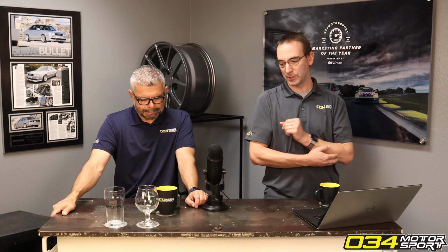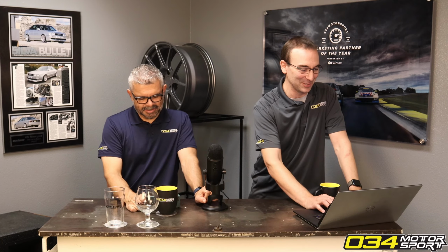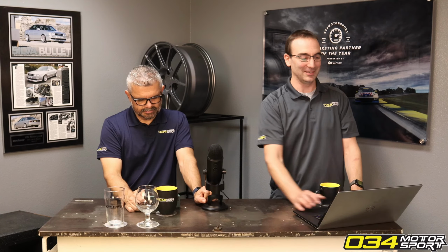That's imminent. We've tested both our E85 low pressure injectors. There was a bunch of mapping stuff that they changed for no obvious reason other than some updates on their software side. They added lots of new ways to turn off crackle overrun, so we worked on ways to turn that back on for you. The OEM stuff's weird because they added, I'd say, a half dozen maps related to crackle overrun and then turned them all off. Some engineer there wanted it, and someone else said no.